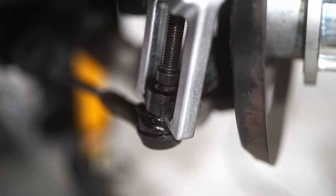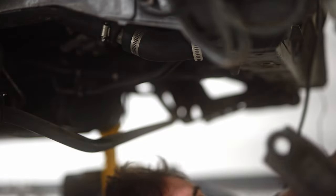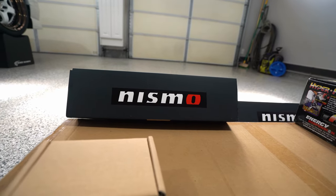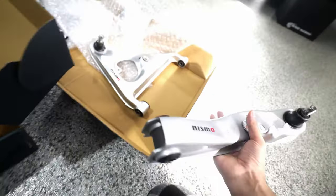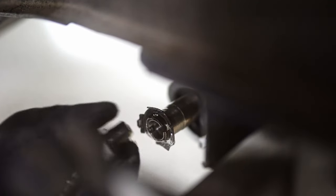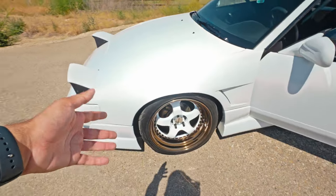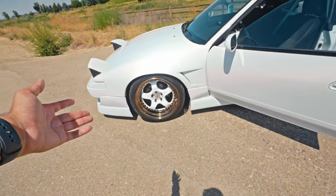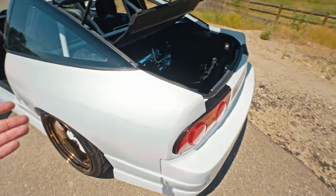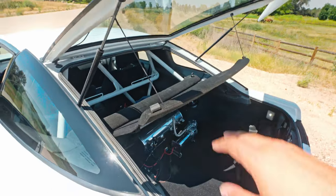That brings me to the suspension install. I installed Nismo control arms on the front, and I have some for the rear that haven't been installed yet — the lower control arms. I did ISR for the sway bar and all the supporting arms, GK Tech for the steering components, and then a Nismo power brace and a few other small things. Just stiffened up the car a little bit and replaced some shot old suspension while doing the coilovers. It turned out pretty nice — it's going to give me the adjustment I need once the engine swap is done and I'm running more power.